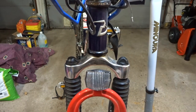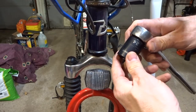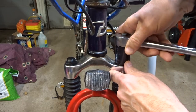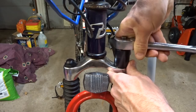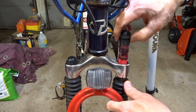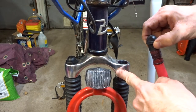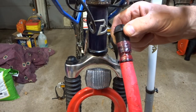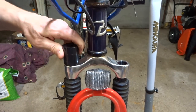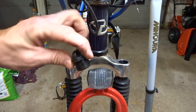Next I'm going to remove the top caps. They are different — this one here is an adjuster cap, and this one is not. I'm going to use a 24 millimeter six-point socket and unscrew these. The whole stack comes out like that. Just remember which side goes on which — that one's out, and that one is just a plain cap.